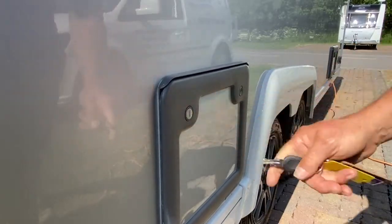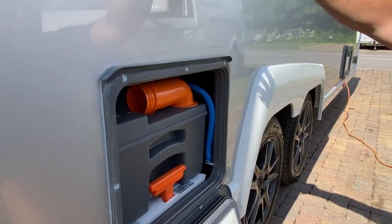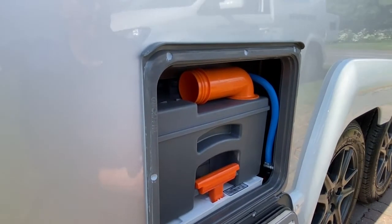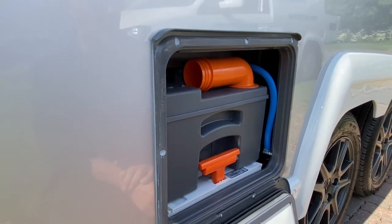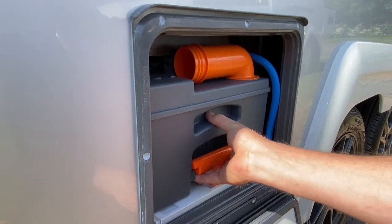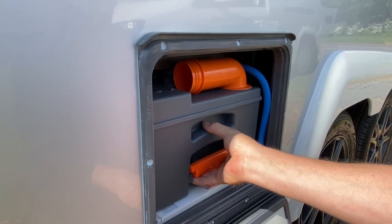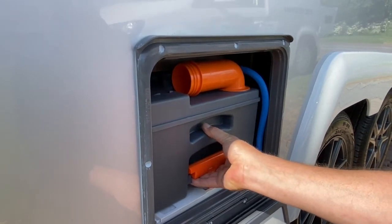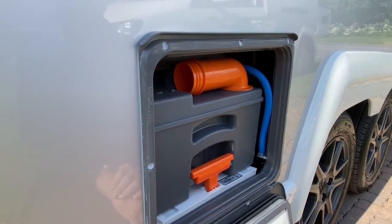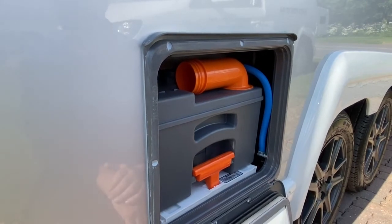This is your toilet cassette. If you've had caravans in the past, you'll notice that on this van there is no flush tank above the cassette holder itself. That's purely because this system is now fed directly from your 40 litre barrel from the external supply. To remove your cassette you just lift the orange handle and slide forward. If you get any resistance when you try to get the cassette out, don't try and force it out — it simply means that the toilet flap inside the van has been left open. Trying to pull it out while it's like that will cause damage to the cassette and also the base of the toilet.